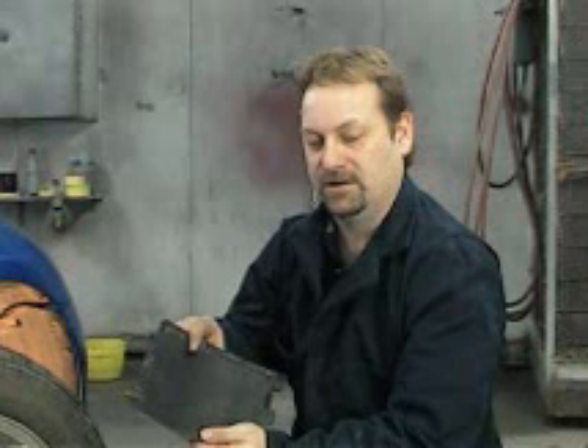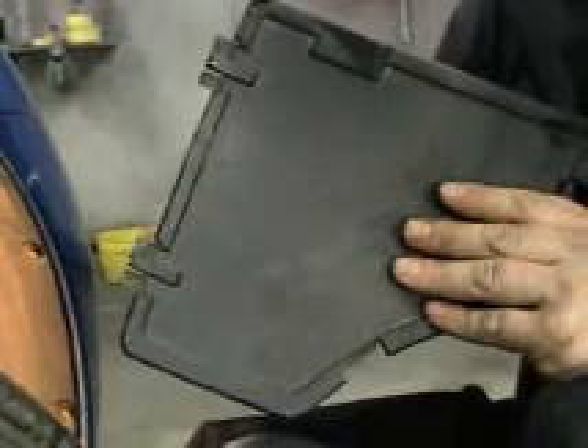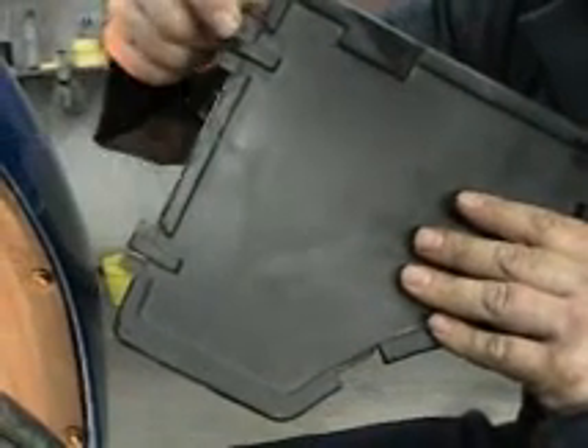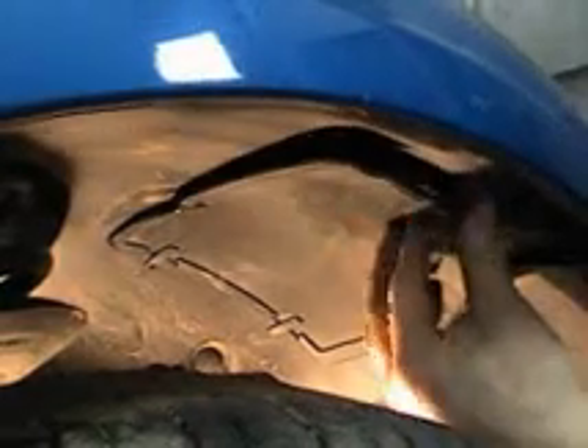Now that we've looked at our headlights and inspected our bulbs, we're going to reinstall the cover for the back of the splash shield. On the inside cover, we first have to click these two little tabs on top of the splash shield before we can install. So gently slip it in — it really goes only one way — and push into place.